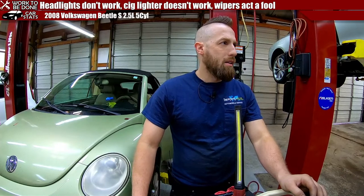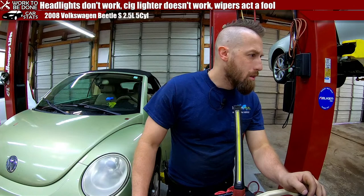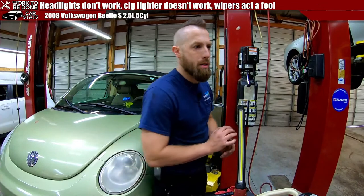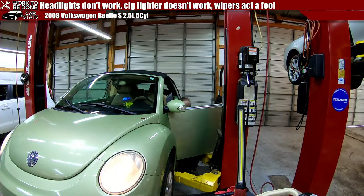All right. Let's look at wipers. Ah, windshield wipers, S24. Windshield wiper washer switch, fuse 24. Oh, absolutely. Wait, that one should be good, because it's where I started with that one. Didn't I? Yeah, it's got power. So our wiper circuit is good.